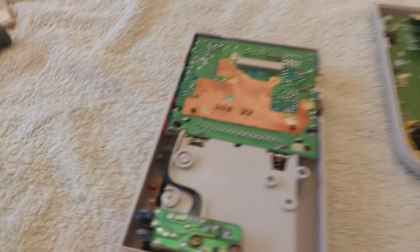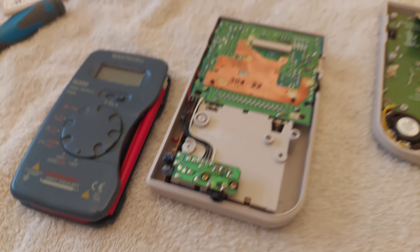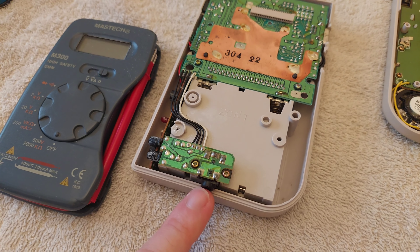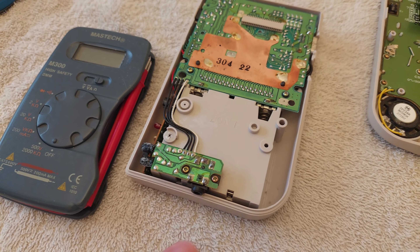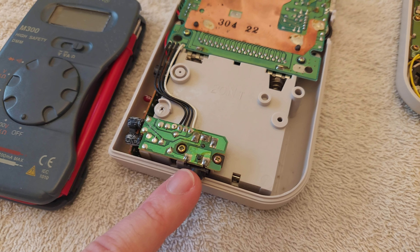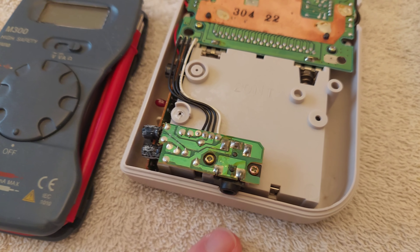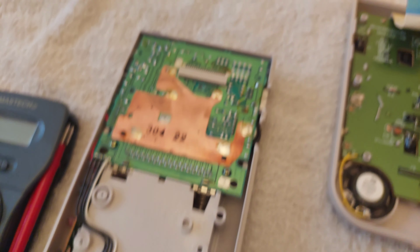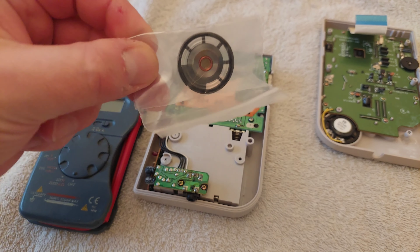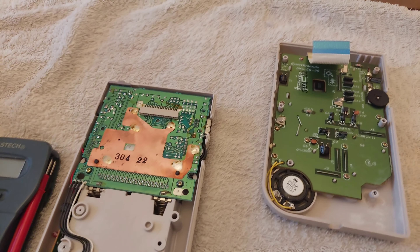The main thing you can do is get a multimeter and check the continuity between the two connectors. If there's no earphone cable in, you should get continuity. If you put earphones in, it moves a little pin inside the earphone connector, which stops the continuity - and you can tell whether or not the earphone port works, ruling that out and meaning it's probably going to be the speaker. I've already bought a replacement speaker - about three quid off Amazon. Hopefully it'll be the right size.